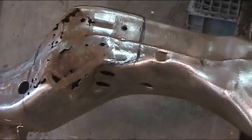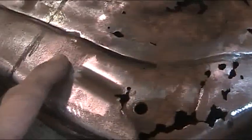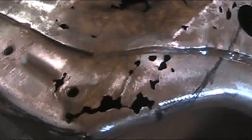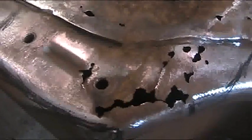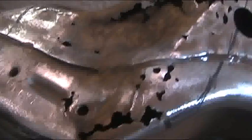This is the bad spot. I'm just not sure how I'm going to do this one yet. But this is where the sway arm bolts in, so I'm going to have to make a piece and put that bracket for the sway arm on there. Make sure it's in the right place. The strange thing is it's got to have that little dimple on it, so I've got to put that in there somehow, because the rubber kind of sets up in there — as you can see on this side, that's what it's supposed to look like. So I'm going to have to reconstruct that.